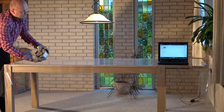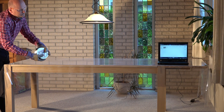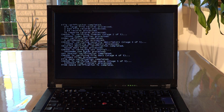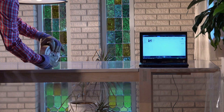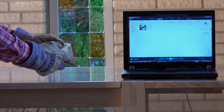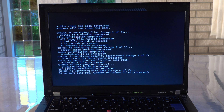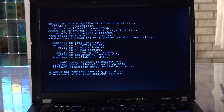The laptop seems to be unaffected. After this test I ran a check disk again — still no problems, so I went closer. 75 centimeters from the center of the laptop, and I even tried 50 centimeters from the CD and hard disk drive on the right side of the laptop. No visible reaction. But there was a new noise when I ran the check disk after the 50 centimeter test — it turned out to be just a cooling fan, so the magnet may have misaligned something in there.